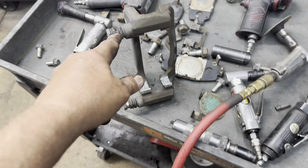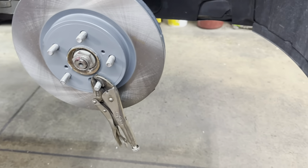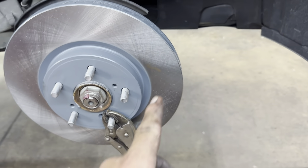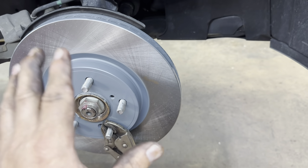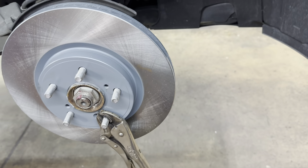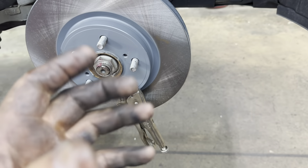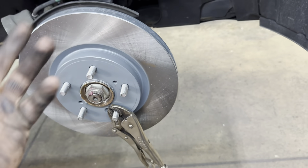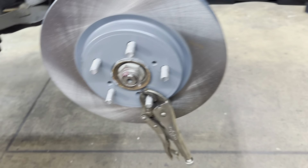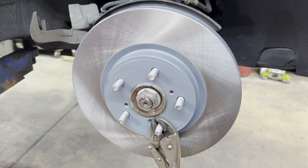I'll paint them and then clean these up and put some new Silglide on them. Once you've got the fine film of anti-seize on your hub, get your new rotors and clean them up. Use some soap and water or some glass cleaner — not brake clean, because brake clean is extremely cold and it shrinks the metal and locks in the grease. Use warm soapy water or glass cleaner, wipe them off, and put them on.